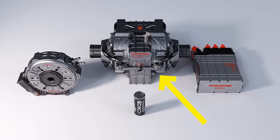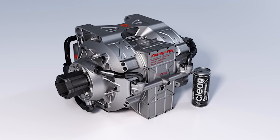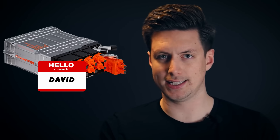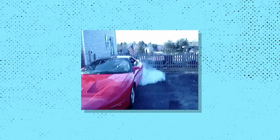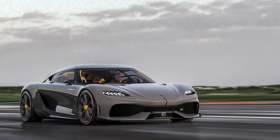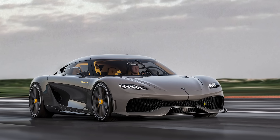At the same time as announcing the Quark, Koenigsegg also announced the Terrier — their name for the new electric drive unit, which houses two Quark motors and a single David inverter. Yes, they made their own inverter, and yes, they called it David — as in a David and Goliath reference. Not only is it compact, but it can run two motors at a time where a regular inverter can only handle one. Despite the Terrier's total weight of 85 kilos, it's still capable of 660 brake horsepower. It's also a torque vectoring unit, which means it can electronically vary the torque sent to each wheel, helping the car rotate and slowing wheels individually for much better handling.